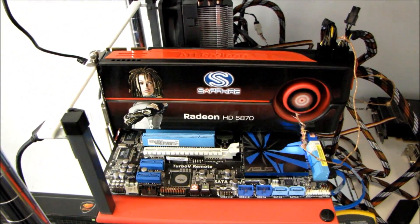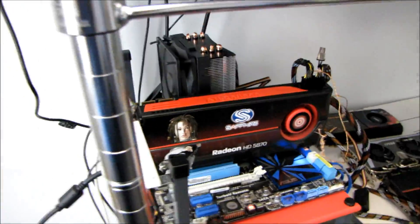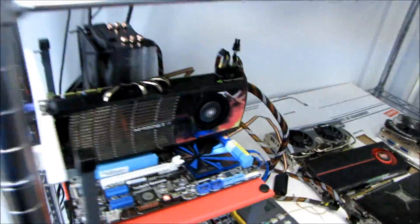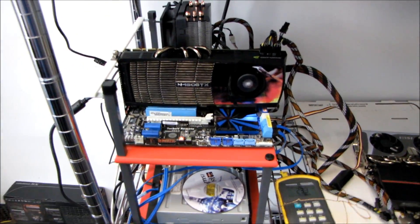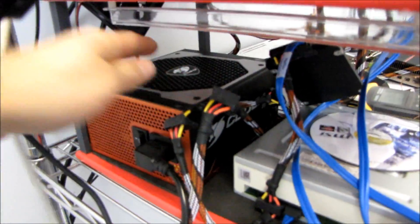With FurMark and Prime 95 running, for the 5870 you'd need another 50 to 75 watts of available power on your power supply. I usually overbuy on the power supply so it runs nice and quiet, because most power supplies ramp up the fan aggressively past about 50 to 60 percent load. With the GTX 480, we're looking at about 550 watts from the wall — so the power supply is providing about 500 watts. A 500 watt PSU with a GTX 480 and an overclocked quad would be stressed to the max under extreme load.